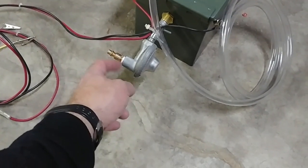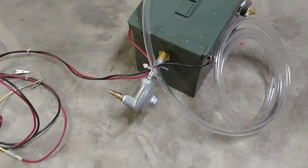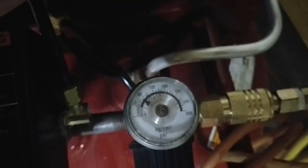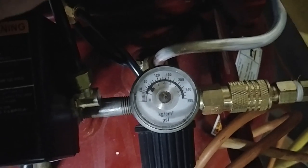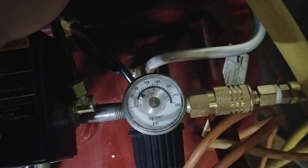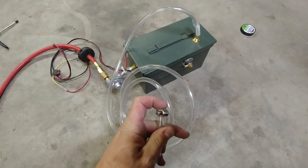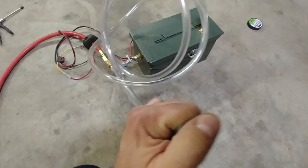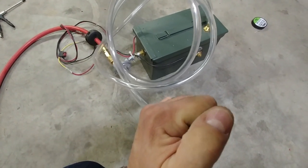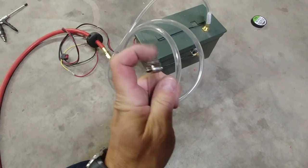All you need is a couple of bulkhead fittings, some tubing, and some hose clamps. On the high-pressure input side, I use a quick disconnect for my air line. We currently have about 60 to 70 psi coming out of my air compressor. Now I'll show you on the other end how much actually comes out of the smoke generator — you can hear the hissing. If I put my finger on here, you can guesstimate how much air this really is. It's a good blow — not wimpy, not weak — but it will not damage any sensors or the interior of your fuel injection system, because this is very low pressure.